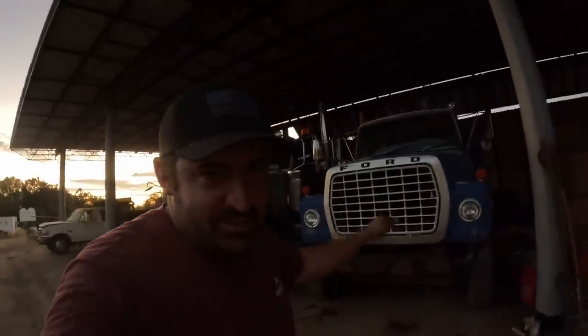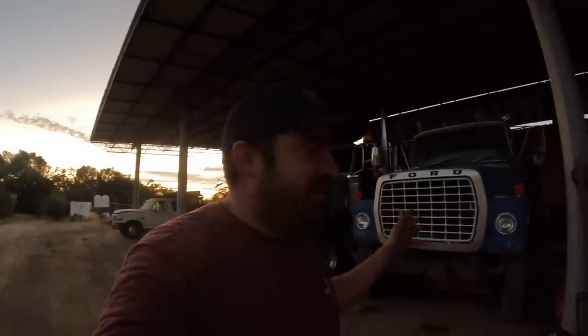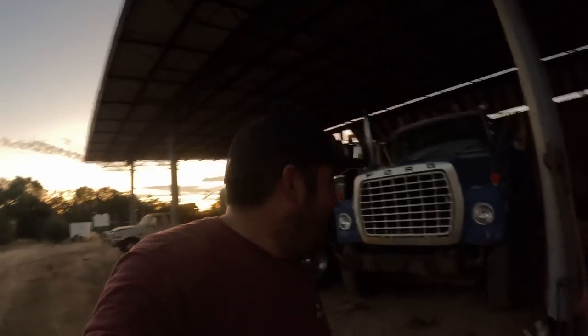So every day you're supposed to empty out the tanks, or at least every other day. I would do it every day, every time, because if not, you're gonna have a lot of components that end up failing. The moisture just wreaks havoc on everything. Kind of like the regulator that's on the control panel for all the sprayers.